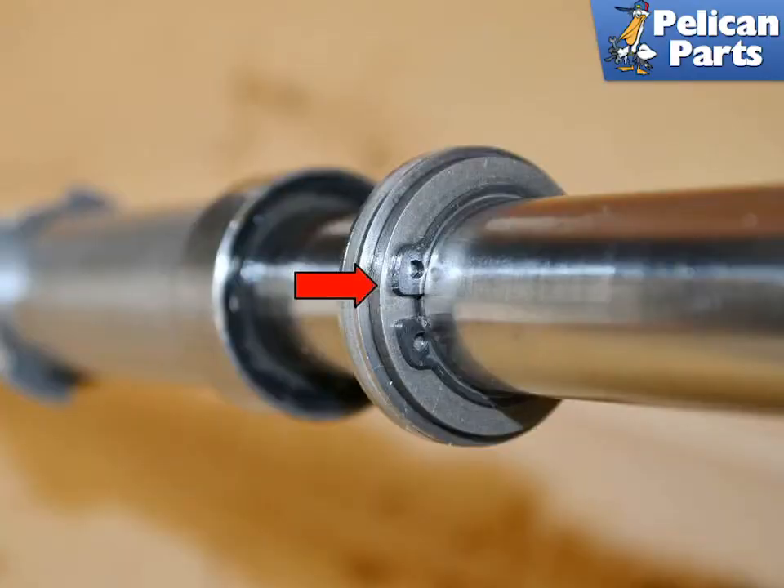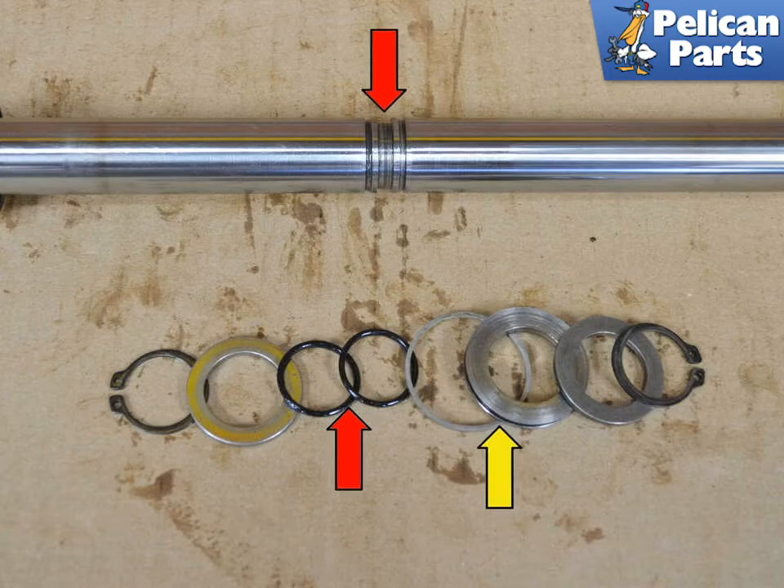You need to remove the sleeve to replace the seals on it. To do this, remove the series of circlips and washers on the rack — you will be replacing some of these components as well. Use a proper circlip tool; it is very important you do not scratch the rack, so use the right tool. Remove all the clips and washers, keeping track of the order they came off in. In the rack there are grooves for the circlips. The center groove is for the two rubber o-rings, with the metal washer and teflon washer sitting over the rubber o-rings. Remove the circlip, washer, larger washer with the teflon o-ring, two rubber washers, metal washer, and other circlip. Remove the teflon o-ring from the large washer and replace it with the new one. Install the two new rubber o-rings when reassembling — the large washer with the teflon o-ring will sit over the rubber o-rings.